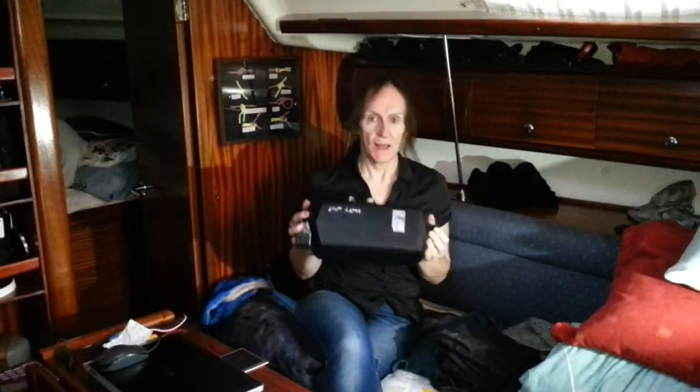I'm back and the Eberspacher is back with me. What the service centre has said is that it's almost certainly down to running red diesel — the ones that come in most regularly are the ones running on red diesel. Truck units running on white diesel come in much less frequently, typically every year to a year and a half, while red diesel ones are in every three to six months. The gumming up we're experiencing is almost certainly due to the lower combustion temperatures you get with red diesel. So now we have to decide whether to start filling with white diesel — it is more expensive, but if you offset that against the cost of getting the Eberspacher serviced, there's a point to be made.